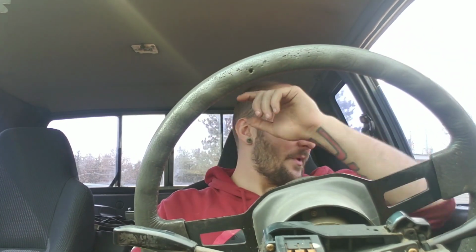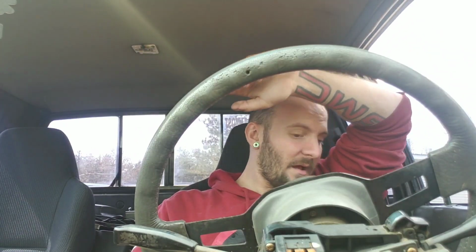I'm still up in the air about a cage. I think the cool factor of a cage would be there. I'll see how it handles. If it's sketchy at all, I'm going to cage it. I might just do it anyway. If I do cage it, I want just a main hoop with an X and my harness bar. And then I'll probably run door bars with pins so I can get in and out really easily. I mean, this isn't that bad anyway, but just for convenience purposes, and that way I can take it out if I'm not out sliding.